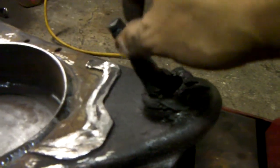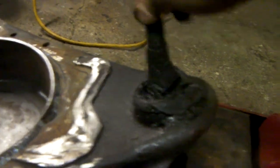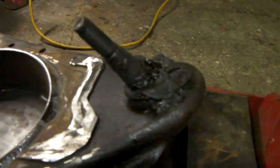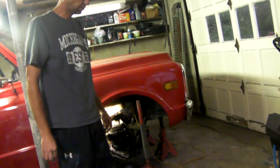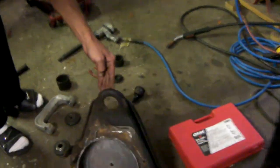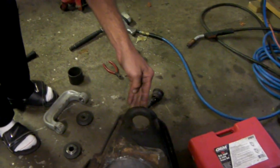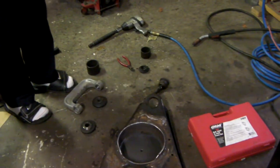Here's the passenger side lower ball joint and this is why we are replacing it. It's not supposed to do that, so it's getting cut out. Nick's here with the ball joint press tool. You may remember him from our classic hit, the PT9K video. We got the one ball joint already pressed out. We didn't show you how we did it because it was the first one and we didn't want to look like idiots, so we'll show you guys how to get the second one out.